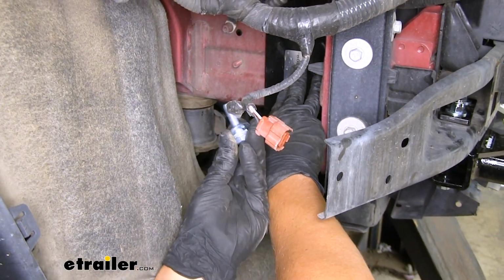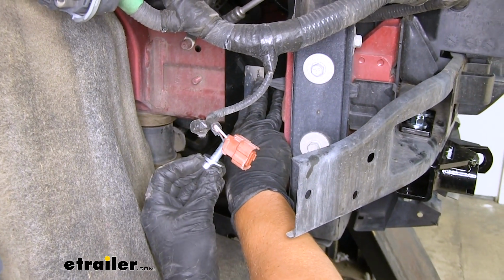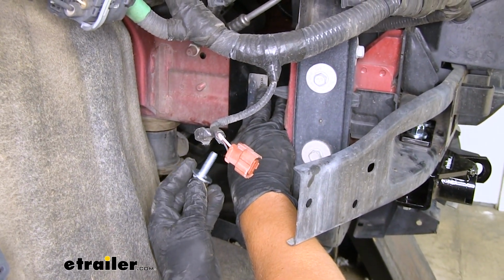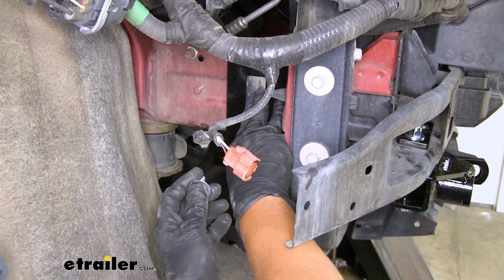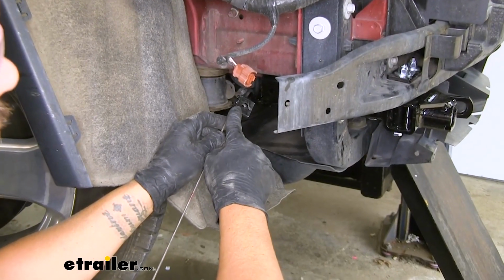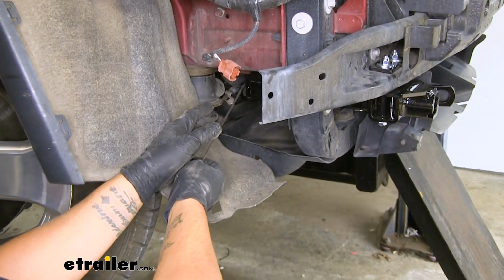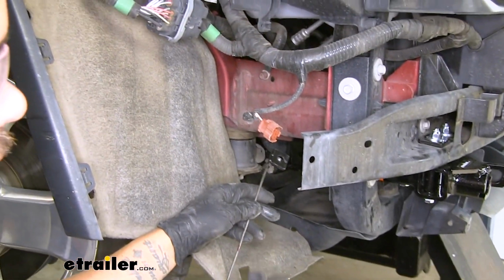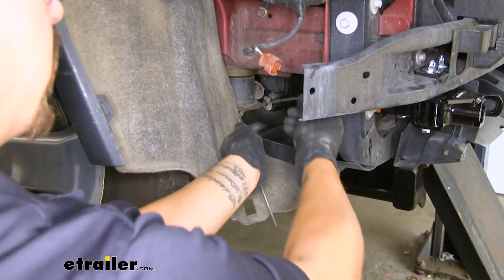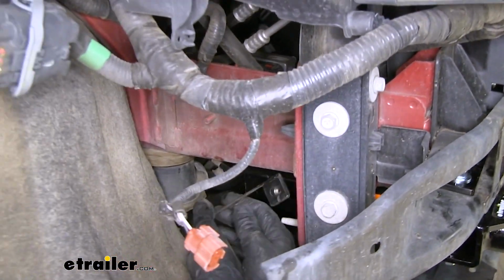And then we'll take our 3/8 bolts, about 1.5 inches long, with a lock washer and flat washer. And again, all the hardware is going to get red Loctite, but we're going to be going through the plate into the inside of the base plate. Now we're going to be using a nut plate. We're going to have to bend this handle so it fits on the inside of our base plate, and that's what our bolts are going to be attaching to. Just bend the handle a little bit and get an idea of how far it needs to go in.